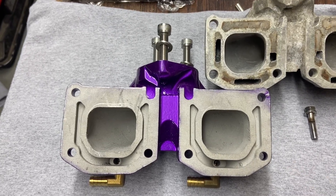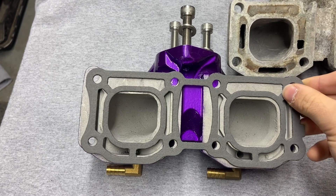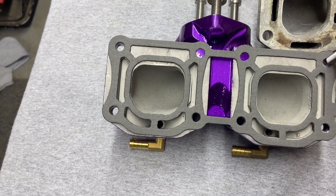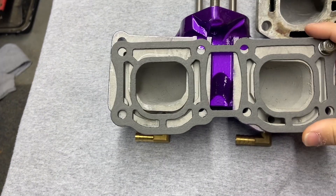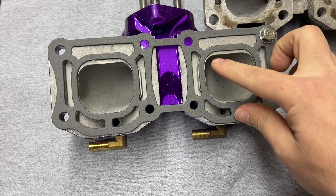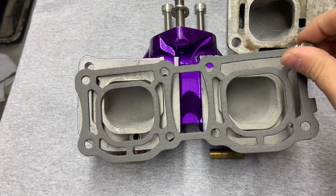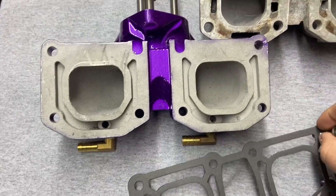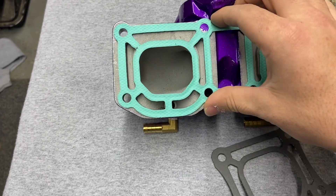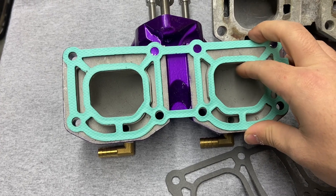So I did some research and found that High Speed Industries makes a manifold gasket that fits 61x bolt holes so you don't have any play, but it also has 62t exhaust ports. As you can see, you have the exhaust port size that fits perfect. If you had a 61x manifold gasket and put it on here, it fits right now but you would not have clearance.